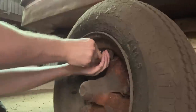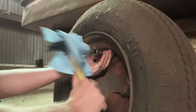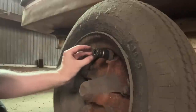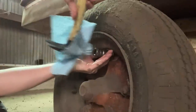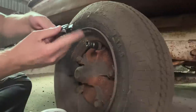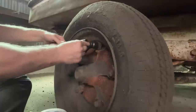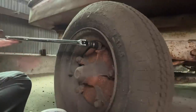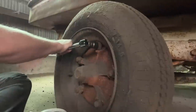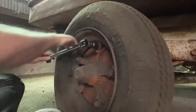To begin, line it up like you normally would a socket bit — it's not going to necessarily want to go right on. I want metal biting into metal; I want the extractor to really clamp on and grip the bolt head, and giving it a bit of pressure will help. Put the half-inch bit into the back of the breaker bar, make sure you're locked all the way in, then begin adding a little percussive force — and that first one gave me my first little twist.